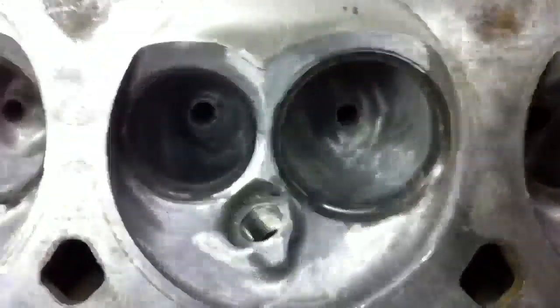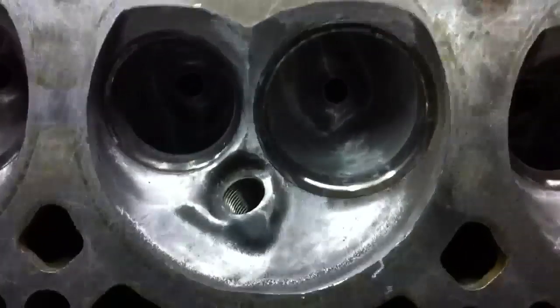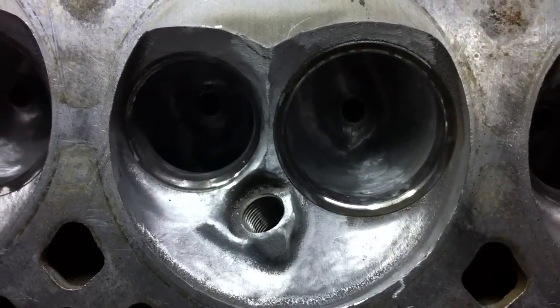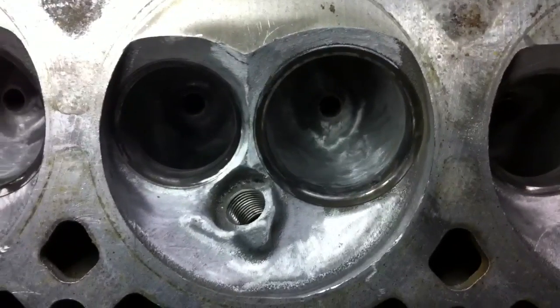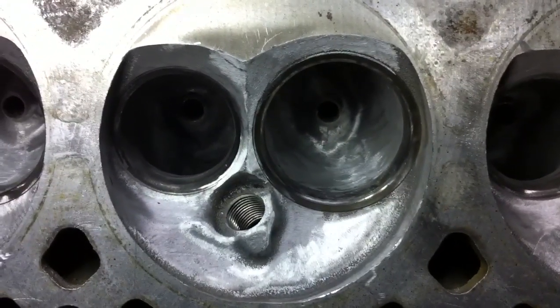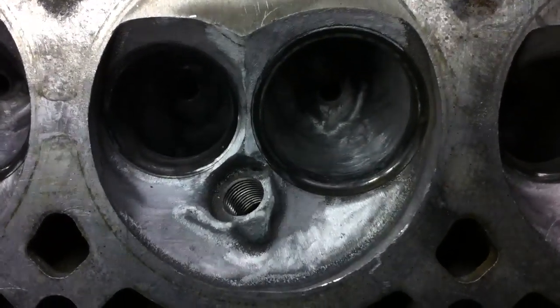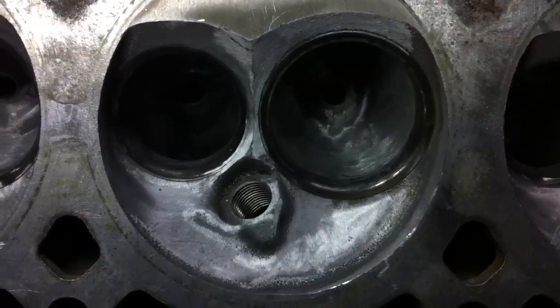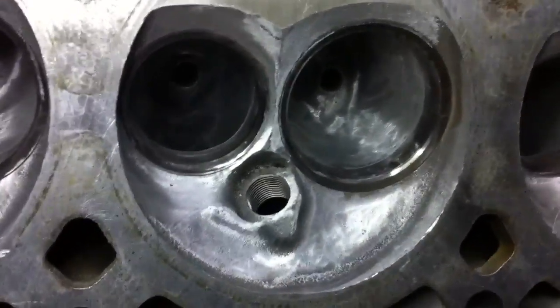A great improvement. Where you'll be surprised is the combustion chamber — I left it with a rough cut, pretty much with the 80 grit just buffed on it. It's hard to show with the light and the reflection off the aluminum after you've sanded it. All I did was hit it real lightly with the 80 grit tootsie roll, just to knock off some of the casting in the combustion chamber. My idea is to remove as little material as possible because I want to keep my compression.